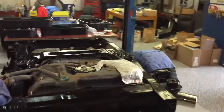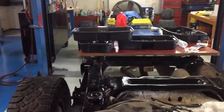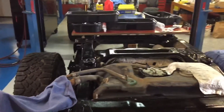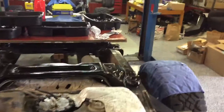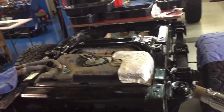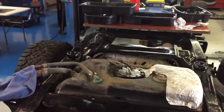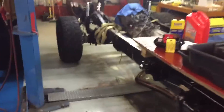But this was supposed to be a nine day job. We pulled it in, we had nine days to do it, before we saw the crankshaft issue. And then once we saw the crankshaft issue, it's like well, now we need to balance it. I've got cranks here — I haven't been too good at keeping the harmonic balancer, flex plate, and all that stuff with the cranks. You could probably just swap it out, but we don't roll like that — I want it balanced. If we're going to swap a crankshaft, let's balance it. It was like 13 grams out of balance, he said it wasn't too bad. Yeah, that's what we got.